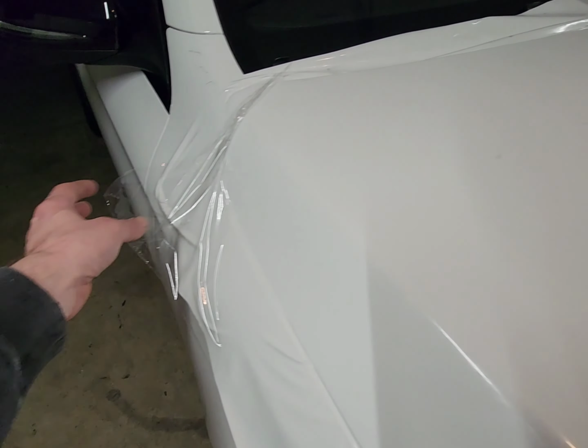And there you guys have it, all finished. I'm gonna go around real quick, show you exactly what it did. And if you're doing a car that's gray or black and you're wrapping it in gloss white, it's very tricky. So let's get to it. First thing that I want to start off with is this area right here. A lot of cars are gonna have this grommet, but this car ain't gonna have that. So you gotta really wrap the whole thing. This is all one piece, just don't stretch it too much right here. And try to work it into the corner, not stretching, and then from the corner over here. It's a little tricky, but you'll manage it, and you'll prevent future issues.